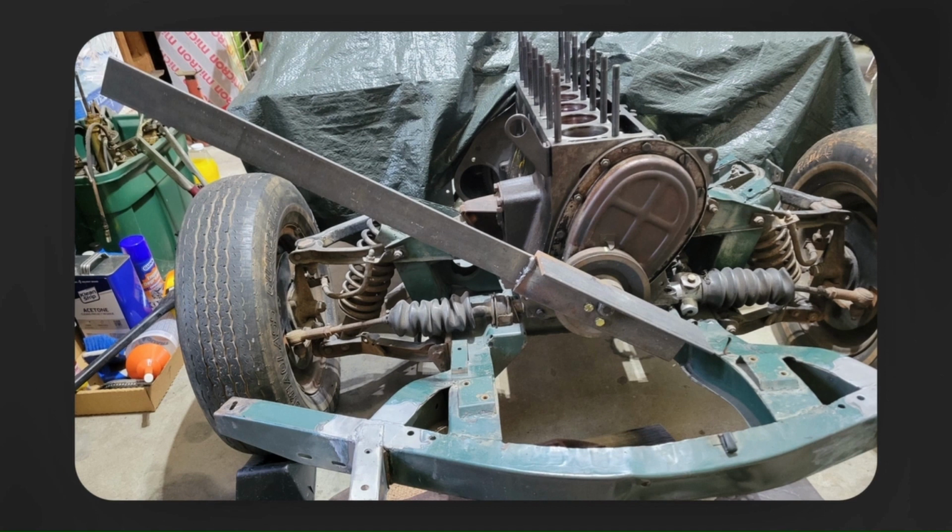We have purchase. Unfortunately, it still doesn't want to move. The pulley rotates back and forth maybe a quarter of an inch, and hopefully it's not simply rocking on the Woodruff key or something like that, but the engine still does not want to budge. The next step, of course, is to apply heat, which is something I've been intending to do for a while. I just have not had the time to carve out to do it.